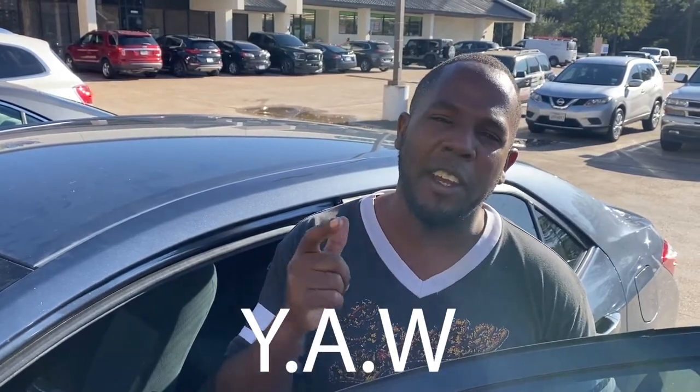So the car went for a wheel alignment the other day. Most of the time it's a Toyota thing — Toyotas have what we call a yaw sensor, Y-A-W. Whenever you have the car jacked up on the air, that sensor is always interrupted. So every time you do that you have to recalibrate the sensor. It's very easy — there's a guy on YouTube who has done it, but since we have a scanner we take advantage of that.